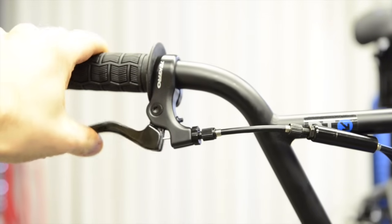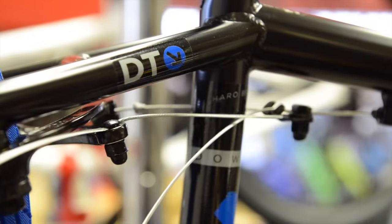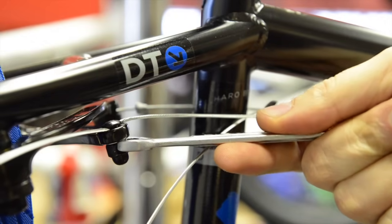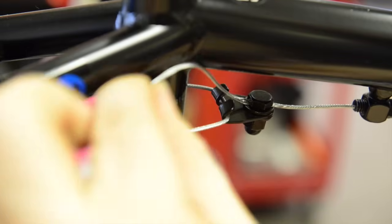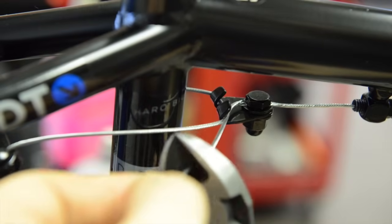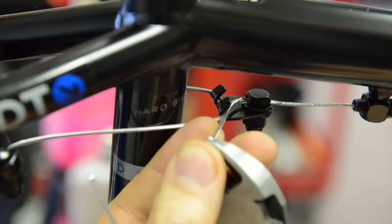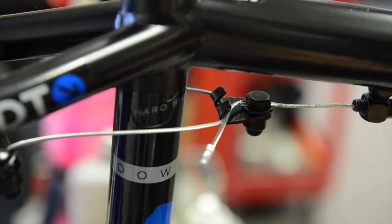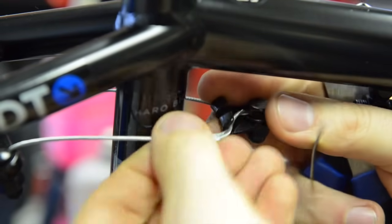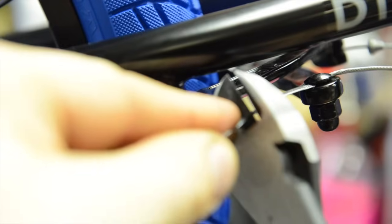We're almost done. Depending on how far you like your brake lever to be, this is where you'll make your adjustments on your rear brake — use the 10mm to adjust. Now to cut off the cable: pull the cable across the cable hanger and cut just a little bit off, then crimp it off with the end cap. Now just play with it a little bit and line it up with the crossover cable, then continue on with the last part of the cable.